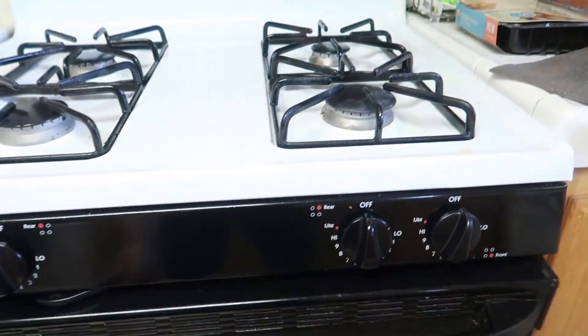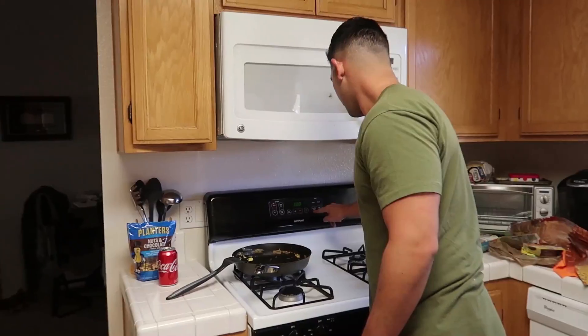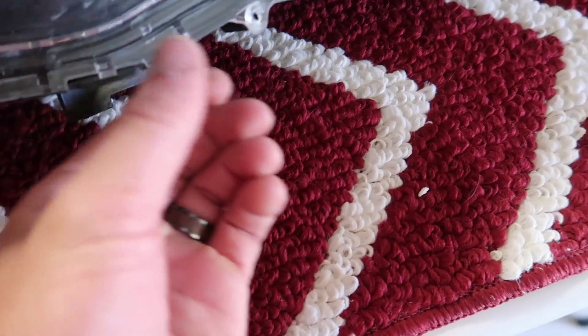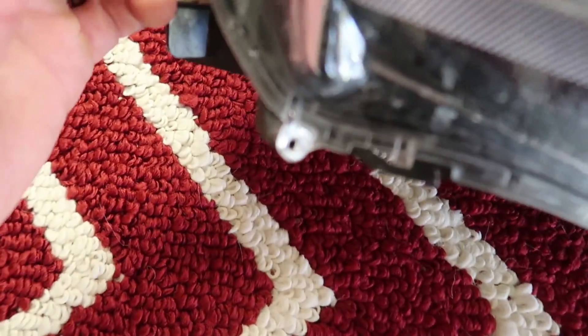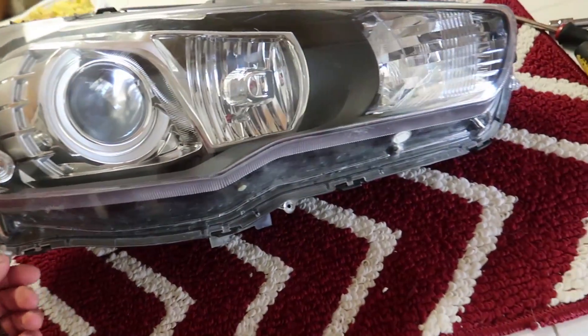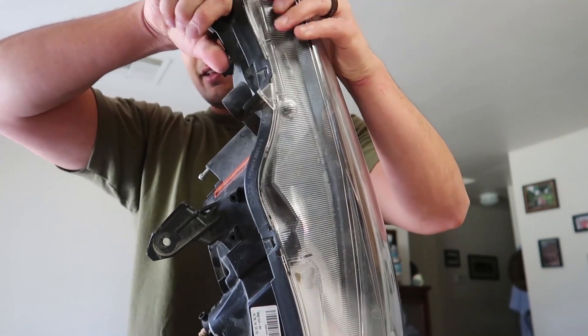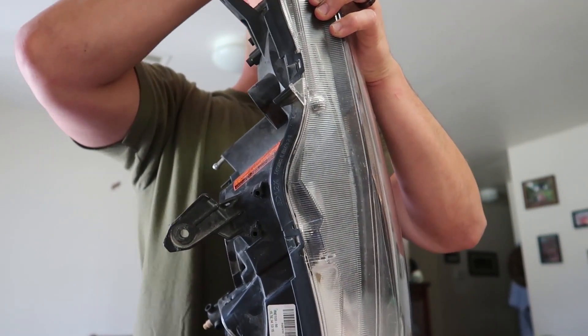Success — it's in the oven. 24 minutes done. Turn off the beep and turn off the oven — you don't need to catch your house on fire. Now we're gonna pry open where all the clips are. Be careful because this is hot — it just came out of the oven. Pry the plastic away from the housing — that means the adhesive is good all around. Don't press too much or you'll break a clip. 24 minutes at 200 degrees is the magic number. You might want to take a flathead to get it started, just pry open anywhere you can and engage the clips.